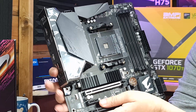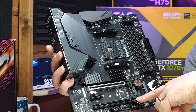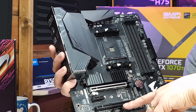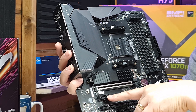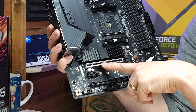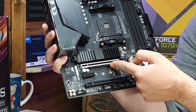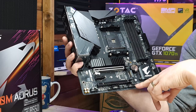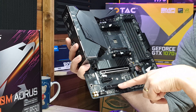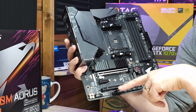Now the most important things. We've got a PCIe slot that looks like an x16 but is actually only electrically x4, running through the south bridge of the chipset. There's also a PCIe x1 connection. These are limited to x4 due to PCIe lane constraints. This is a PCIe 4.0 slot with extra physical support for the heavy upcoming graphics cards like the Nvidia 3000 series GPUs. You can also use the PCIe x4 slot for storage cards.